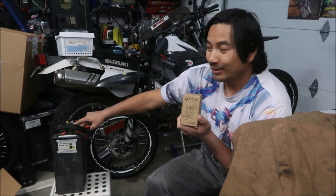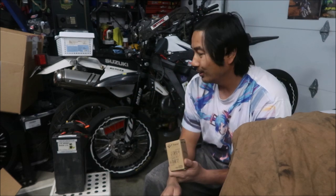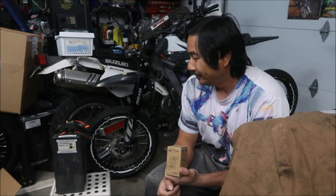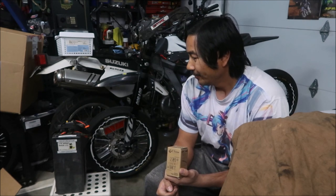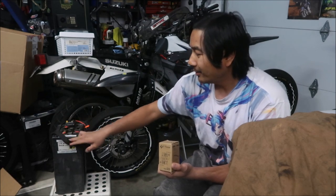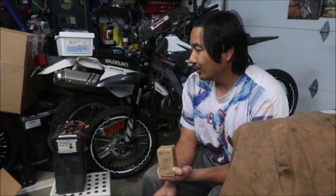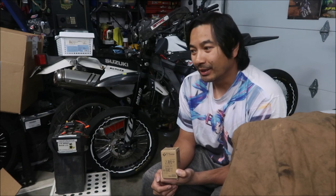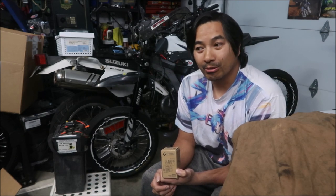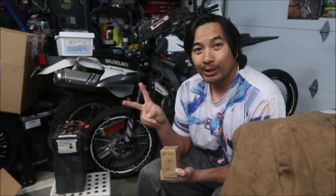The breaker means when you connect the battery it doesn't spark. I'm trying to fix the battery, and the problem I think is the breaker on top of it — it's a 200 amp breaker. We could either eliminate the breaker altogether or replace it. We're going to replace it and see if that's the culprit.